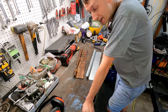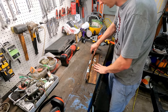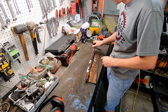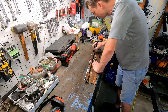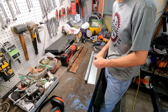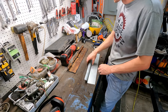A few moments later — my arm's a little tired from swinging the hammer but we got our piece made. It's not quite perfect on the end — I think I cut a little crooked — but we take our old piece, we overlap it, and we are pretty close considering we're working with a rusted old piece. Before we do a test fit, I should probably transpose the holes that attach to the front bed rail — it's like a big C-channel piece. So we're just going to loosely mark that on the inside here to have a reference of where they're supposed to go. Then I want to take it out there and do a test fit.